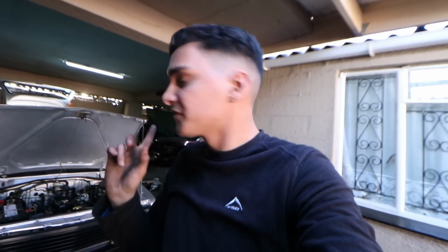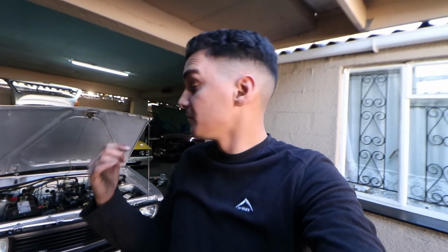But by the way, we actually added a bump stop in front because I remember with the previous Champ we installed these sleeve over kits, it actually gave a nice bottoming out sound from the strut. In this current situation, we installed I think a 15mm bump stop. Hopefully that will prevent the bottoming out sound from the shocks.